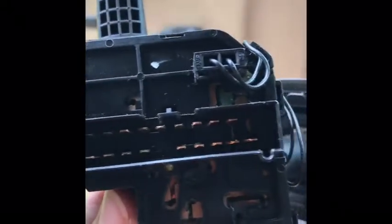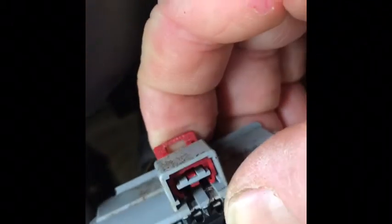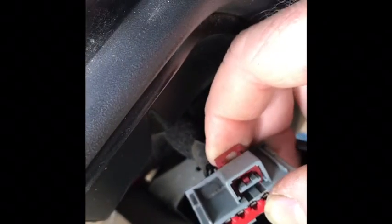I finally got the switch out. There are two sets of wires that connect — you can see one set there and another set there. It's a two-hand job to get those sets of wires unplugged. There's a safety lock — this red piece right here. When it's in, it slides forward and locks it, keeping it from sliding out inadvertently. When you want to pull it out, take a flathead screwdriver, slide that back, then depress the button on top — you'll see that releases the catch. Then wiggle it off with two hands. The exact same thing applies to the other connector.